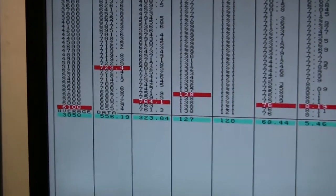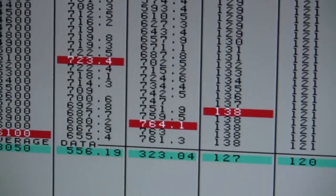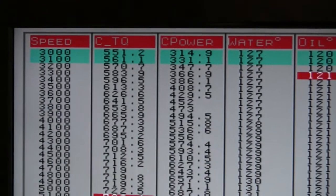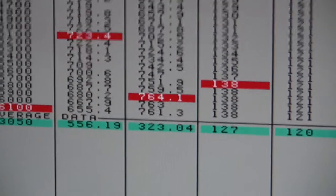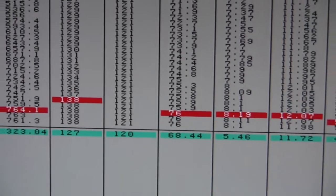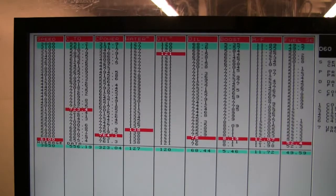So at the lowest horsepower setting: 764 horsepower, 723 foot-pounds. But if you look at the torque curve, it's 551 at 3,000 and 723 at 5,000. It's just a beast — and it's only 8 pounds of boost. When you consider it makes 38 pounds of boost at full song, you really get a feel for what this thing's capable of.